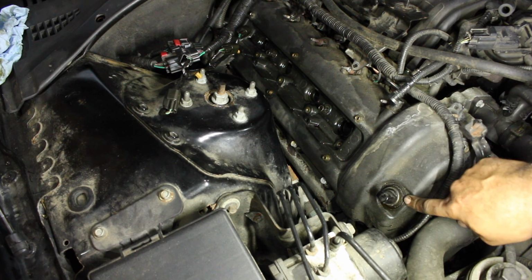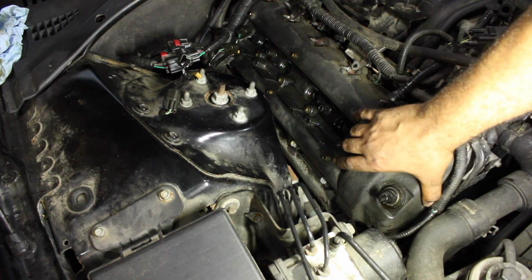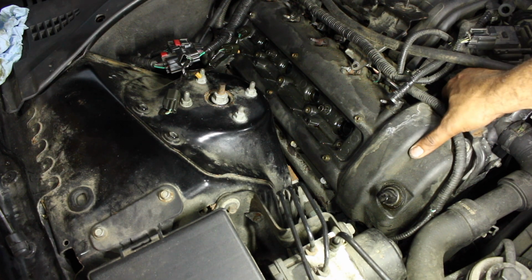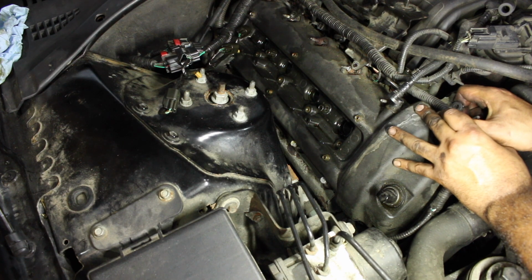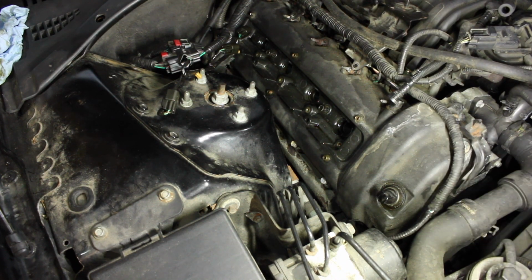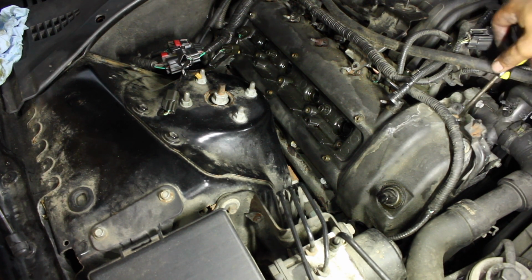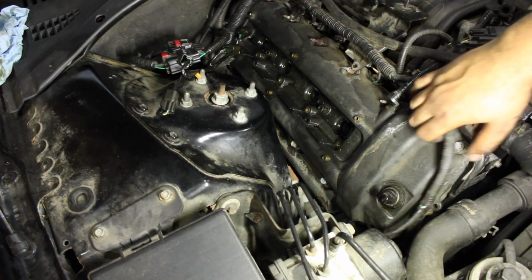It is part of a solenoid that goes in the engine for the cams. So you can push right up on this Christmas tree tab, and it should, the other side just popped up. There's also RTV right there, which is probably what's making it slightly more difficult. So this is basically a pry point. If I knew how to pry, it would work perfectly. There we go. Now it's up.